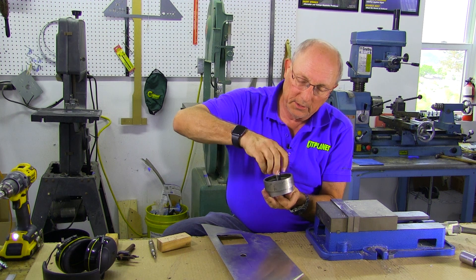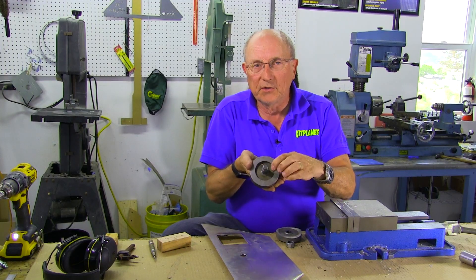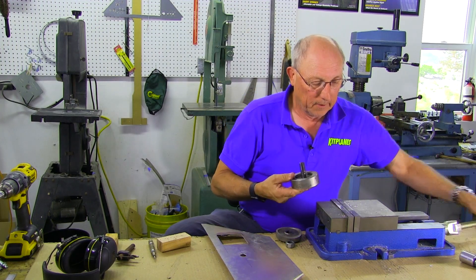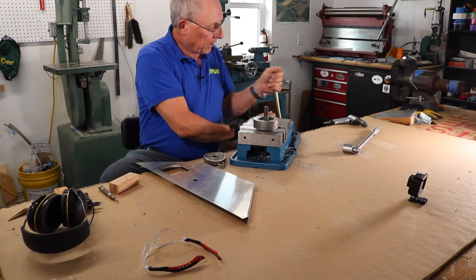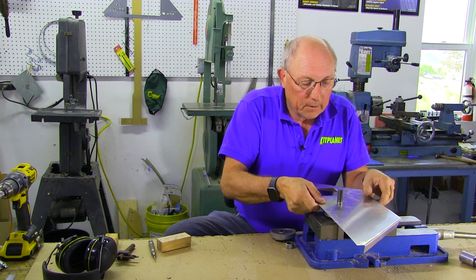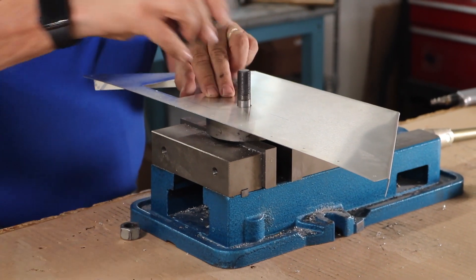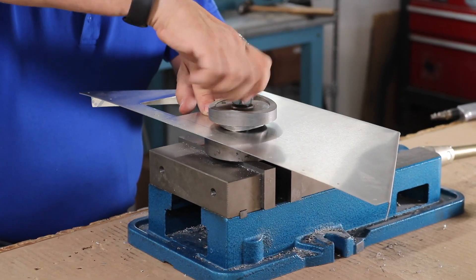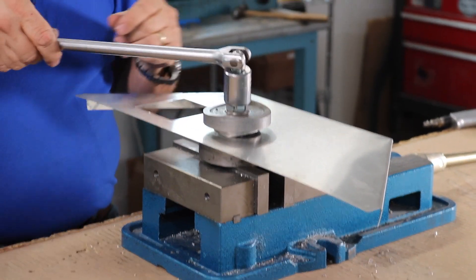Now we are going to take our cutter and take the nut off. This is the female side of the small instrument hole, and we are going to put this in the vise — we'll let the vise do the work. Depending upon the thickness of the metal you are using, it can take a pretty good amount of force to make this thing pop, so this is a nice heavy vise. Next, slide your bolt in, center that up as best you can, take the male side, slide it on there, and put your nut on. That nut is going to take a 15/16 inch wrench, which is kind of an odd size, but most socket sets have one.